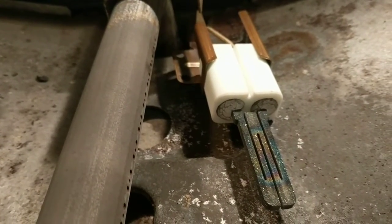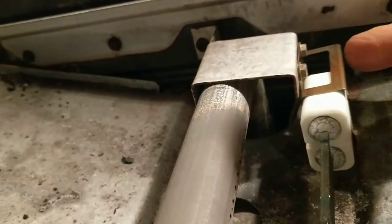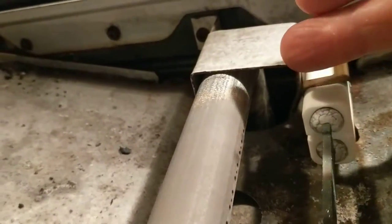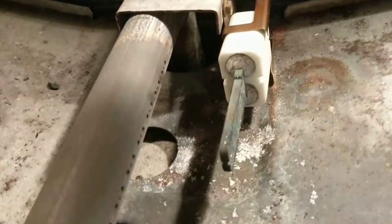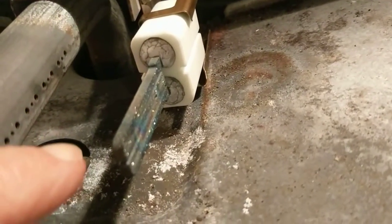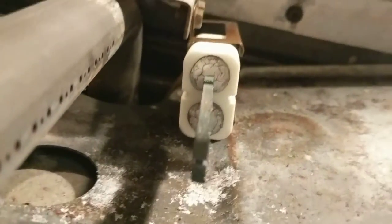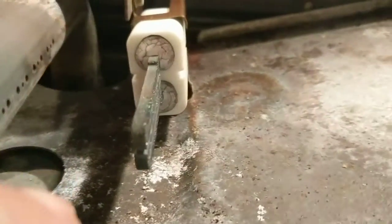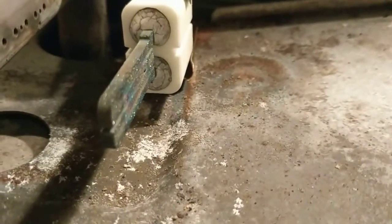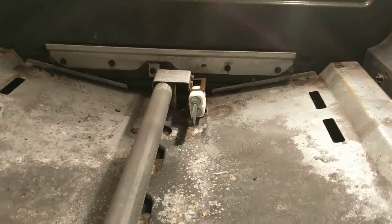I've reattached the igniter. You can see the element is much further forward — it could have been pushed all the way back in the previous setup. This piece of metal can also be bent upward somewhat, and with the two mounting holes the whole fixture can be tilted upward or downward. The igniter is now noticeably higher up — it's tilted in the upward direction compared to how it was before.